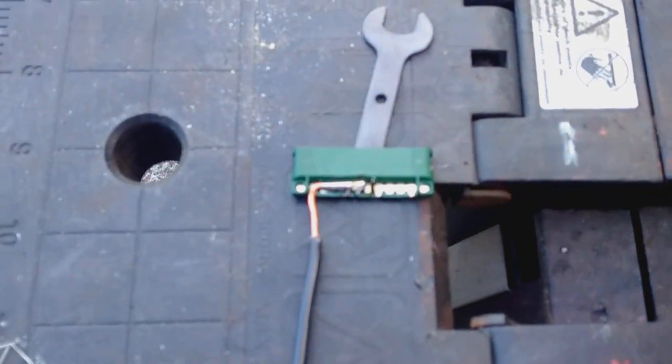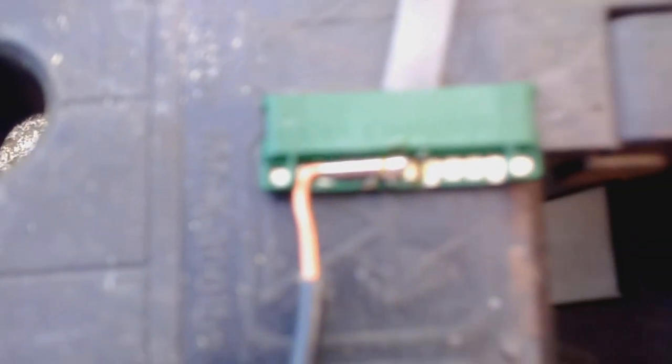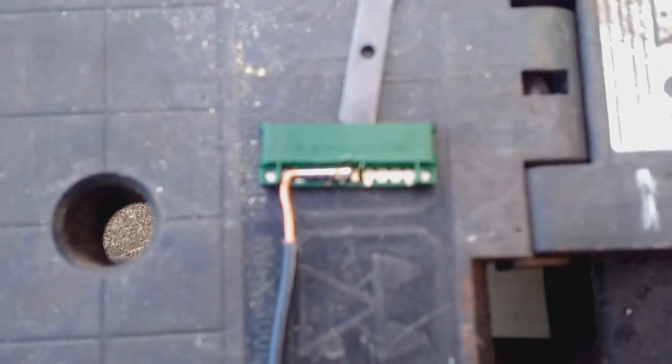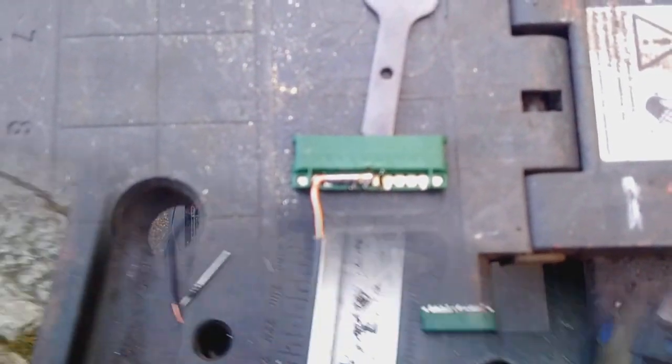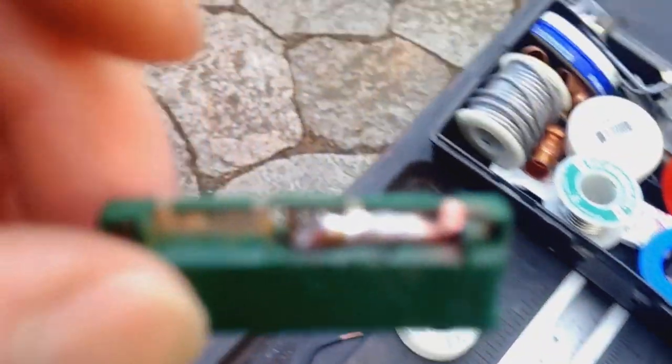Well, this was a bit delicate. I first off tried using just a wire — really tiny threads — it didn't work. So I ended up using house wire, keeping the pins where they're supposed to be. Let's take a look. Oh yeah, they look good. That's the hardest part. So now I'm just going to zip that with my Dremel, and I'm not going to try cutting it just in case I break the solder. There it is. Let's see if we get it in focus here.